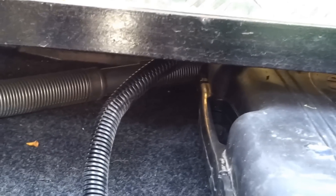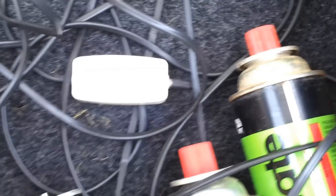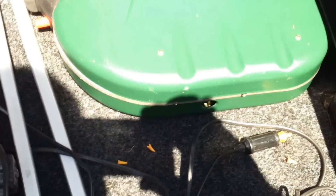I've got power points so I can just hook the fridge up. I've got several of these all over the camper. I also made these lights — I bought them from eBay for a couple of dollars. The frames are from Jaycar. I've seen others make them out of tubing from Bunnings and put lights inside. We also carry our butane cooker in here. It's fine for North Queensland, but when we went through the Simpson Desert the butane didn't work — once it gets below a certain temperature the gas bottles just won't throw the gas out.